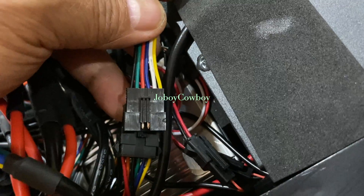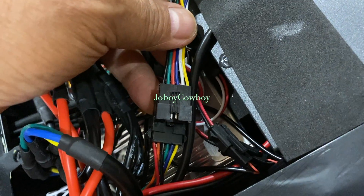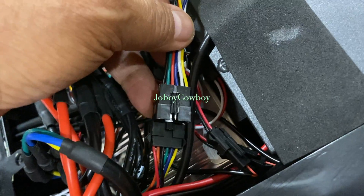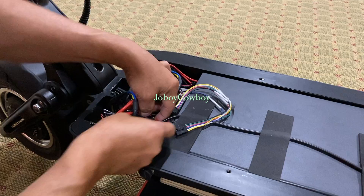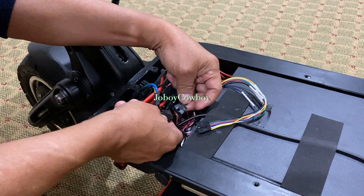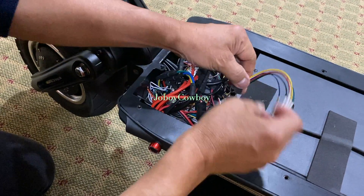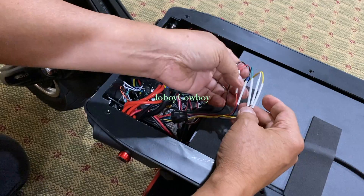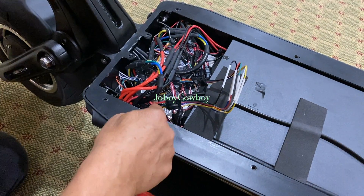I hope you're not confused. Now I will connect this jumper to show you which wire I need to cut in order to cut the throttle while it's connected to power. I disconnected the original wire from the controller to the throttle, and now I will connect my jumper. There you go — on the throttle side as well. Now it's connected through the jumper, and you can cut the wire here so you don't need to cut the original wire.